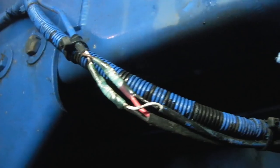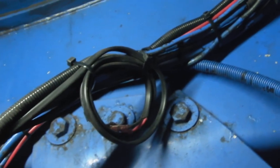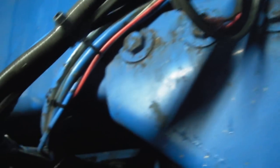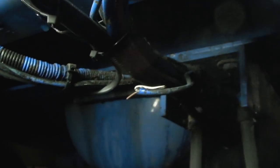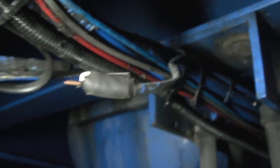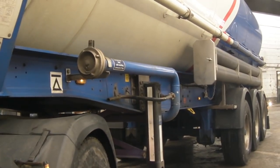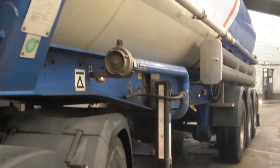So it's lost the feed one side and somebody has put this together. I've had to repair it because this trailer is loaded. What I usually do — just as a tip — is wires like this: I can't leave all the junctions connectors open, sealed up but visible. With this one, I've folded it back so there's no chance of it shorting later on. I'll get back to this later when I get it in for service. Side markers are now working and I can get this trailer gone so it's loading sugar somewhere else.